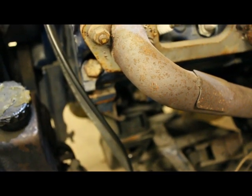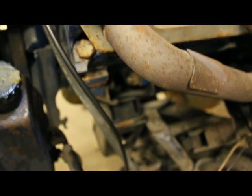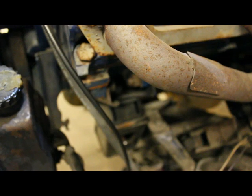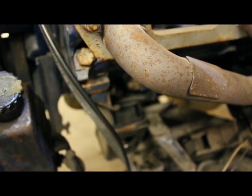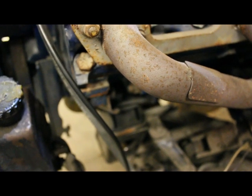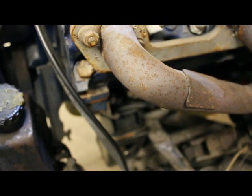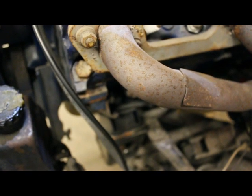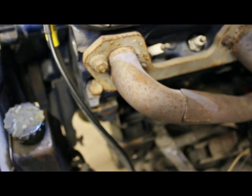The engine mount bolts to the engine which also bolts to the mount attached to the frame. We slotted the holes on both engine mounts and slotted the tranny mount and pushed the engine back. We had enough room in the engine bay to actually achieve that, so it was much simpler than tearing the front of the motor off and putting in electric fuel or water pumps and wiring all that in — because wiring is a word we don't like to use around here. We did manage to knock that off the list.